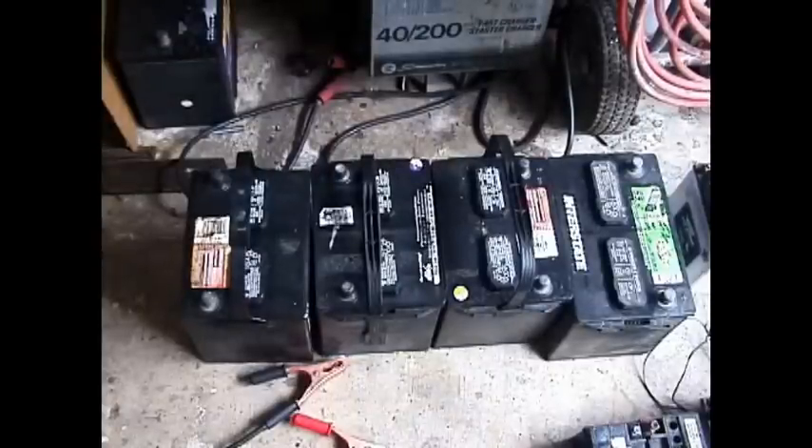All four of these batteries were restored from a junk pile where they had been sitting for three to five years. They are all around 2000, 2002, and 2004 models — old batteries that started out at like three or four volts and anywhere from no hydrometer reading to low in the red. They've all been restored to batteries that will crank a car using equalization, and sometimes Epsom salt and sometimes aluminum sulfate. It's not impossible to take a battery with a hard sulfation on it and have it come back to life.